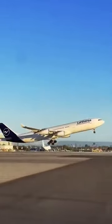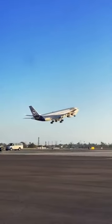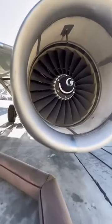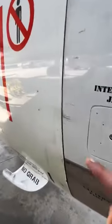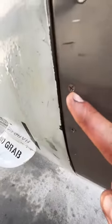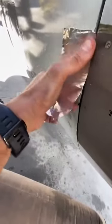Now why do we use this? Airplanes aren't immune to damage. Aircraft traveling at high speeds, exposed to the external elements of wind, debris, and ice, will eventually cause erosion on certain panels. Not all panels are metal — most of aircraft today is made out of composites. Given enough time, erosion starts occurring just like this. When we see this happening, we can perform temporary repairs with speed tape in order to stop further damage to the panels.